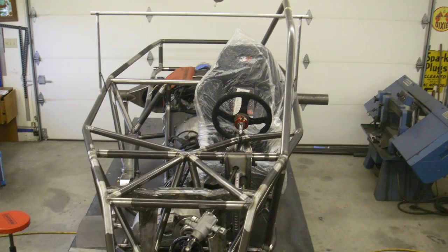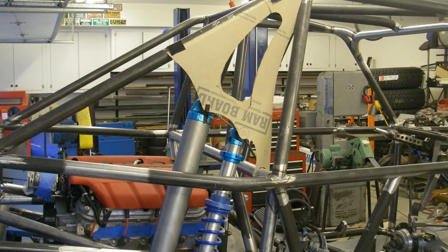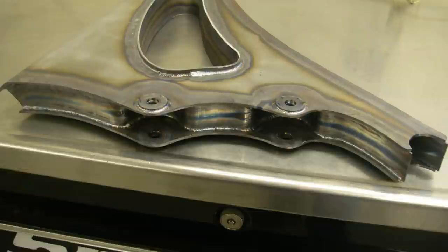Starting on the third story now — and bam! A week later, the top of the roll cage is done. With the lower control arms in place, the upper mounts can be mapped out. Temporary spacers mounted in mid-air represent where the upper shock mounts will be. Cardboard templates of my design are made to tie it all together and then transferred to chromoly plate. The pieces are welded on the bench and then later welded to the car.